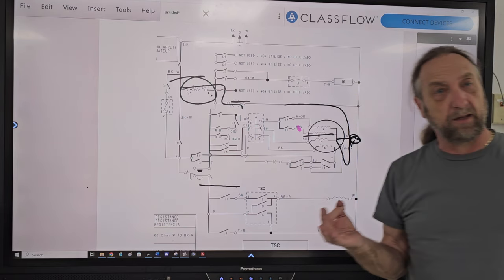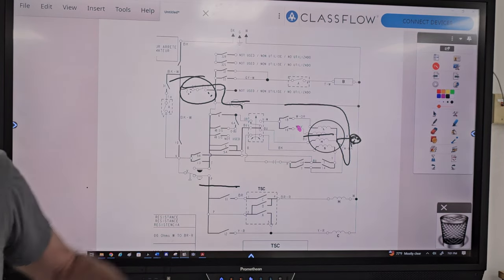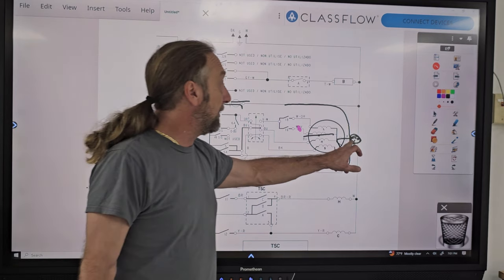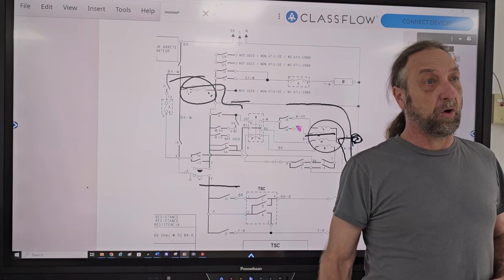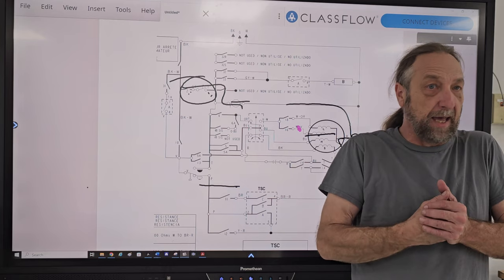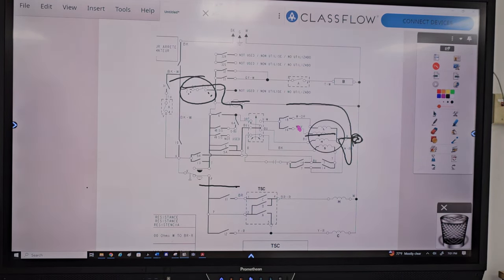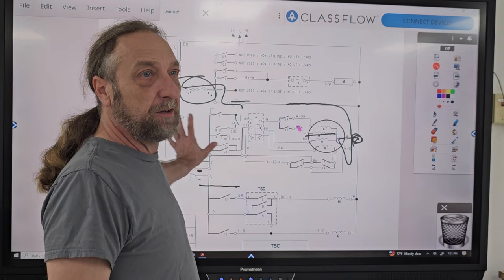So here's another thing that's important. Where they put the switch, I know what type of problem that switch, if it's not functioning, would cause. If they put it on this side, I know it's only for spin and drain. If they put it here, it's spin or agitate. So again, you have to understand these circuits, and that's why we went over so many of these mechanical diagrams. I'm hoping after we come back next week, we can go into more electronic machines. Tuesday, I'm going to have a diagram with actual letters on here, voltage readings, and you're going to tell me what's wrong with the circuit.